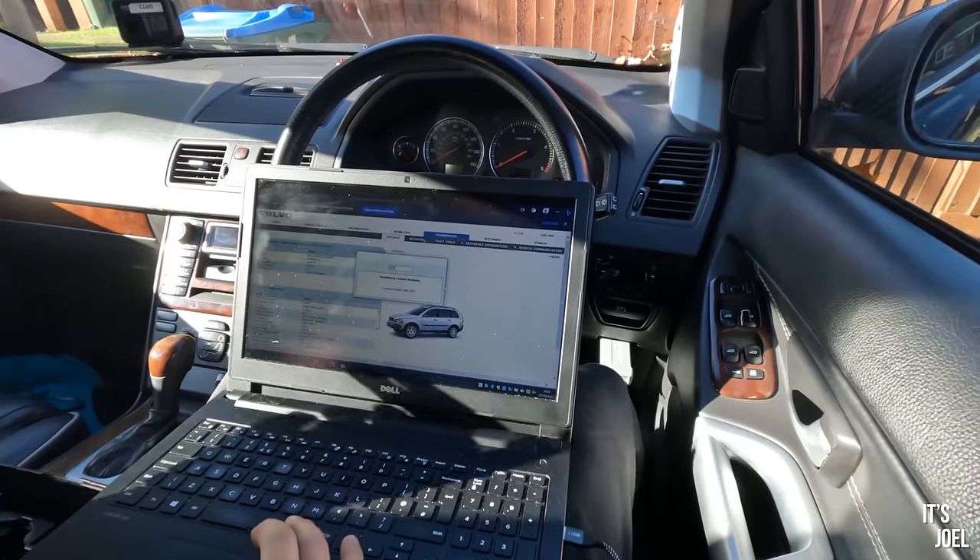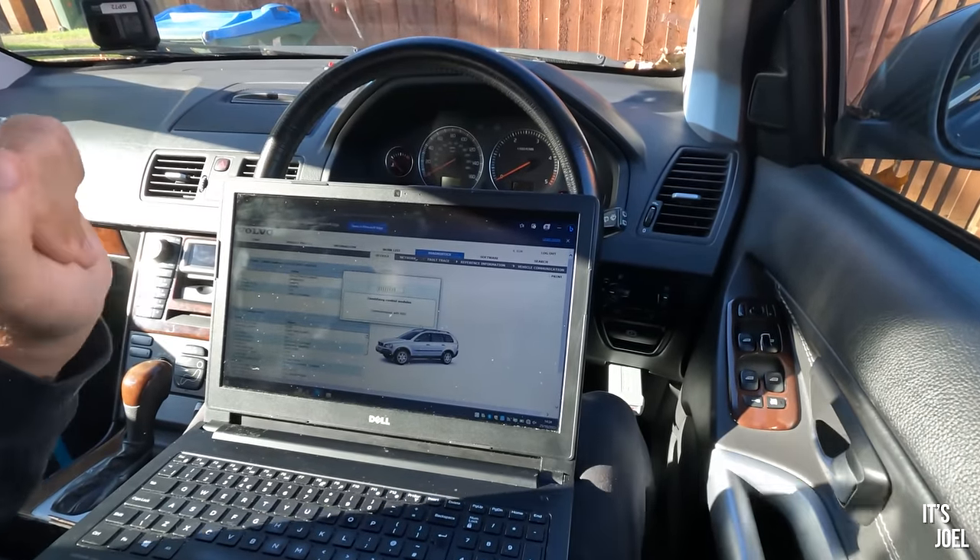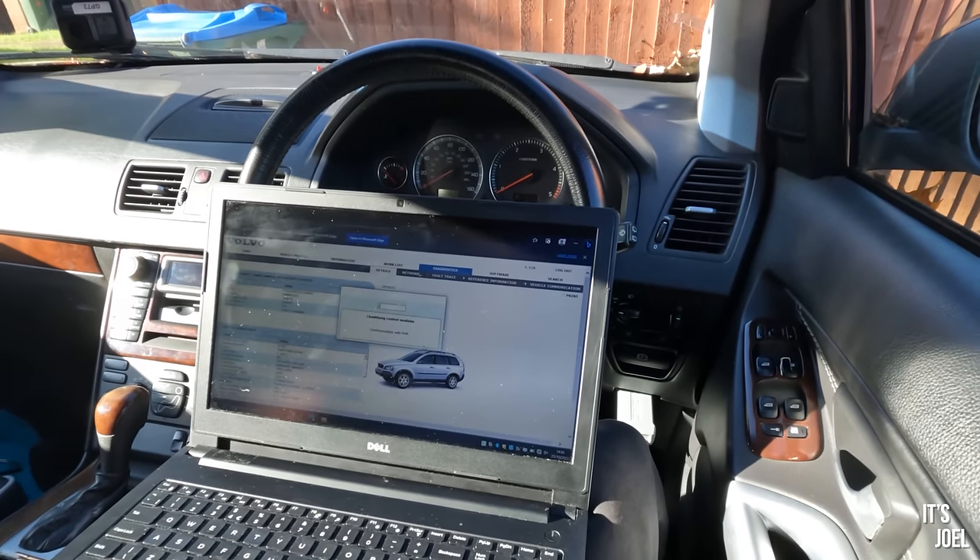Since doing the readout I've also got an ABS light flashing on the dash, which is interesting. This is really good — you can do pretty much everything with VIDA: diagnose issues like most scanners, but also run various tests with the fibre optic system, look at the ABS rings, or code a fuel injector. But truth be told I'm not going to do any of that right now, because I've actually booked this car in somewhere.